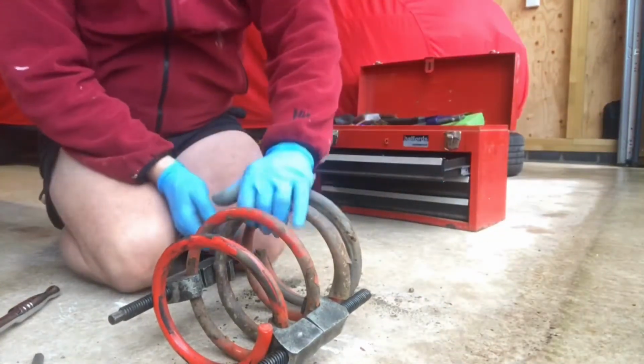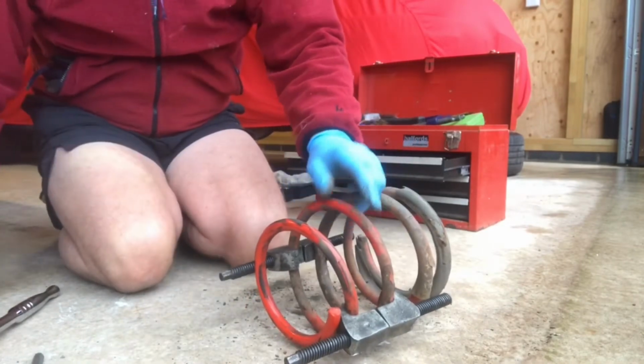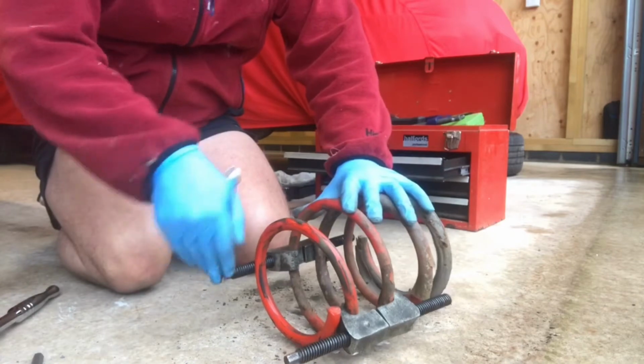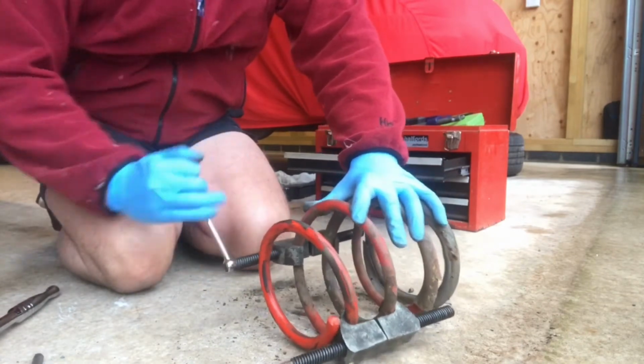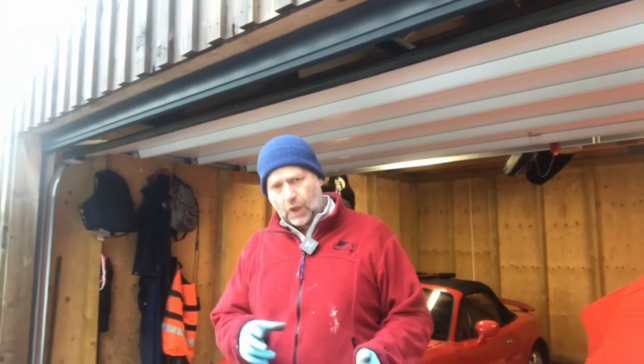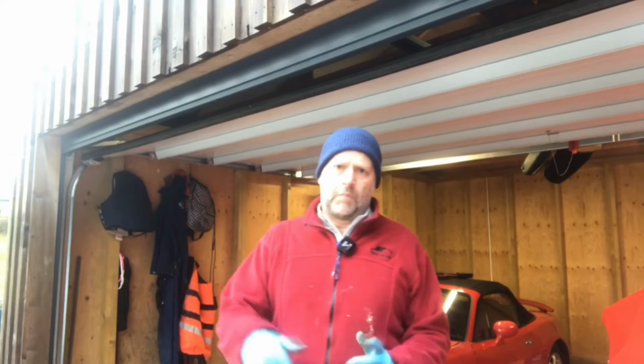And then the final thing to do now is these springs are still under compression, so go back to the 11 mil and just take off some of this compression. We're going to strip the actual new dampers themselves and replace the bump stops over, and then we'll come back and assemble the struts ahead of fitting them back to the car. Okay, so next time you join me, we'll be in a garage with a vice replacing the bump stops.